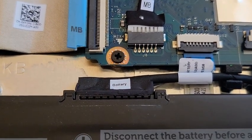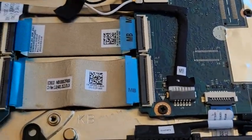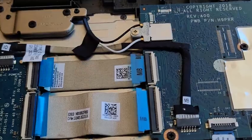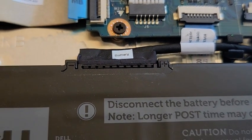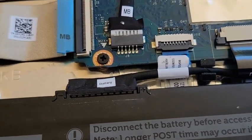It was working and it powered on just fine. So don't be sending them in for service if you're comfortable doing this kind of repair. It's not a difficult repair — just a Phillips screwdriver, take the screws out (they don't even fall out of the case, which is great), reseat that cable, and you should be set to go — unless the battery is dead, but that wasn't the case here. Another quick tip to save you some money if you're good at DIY.